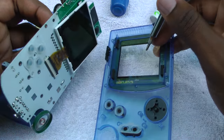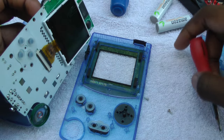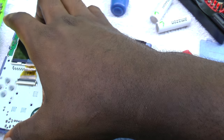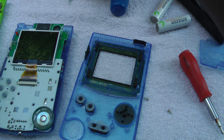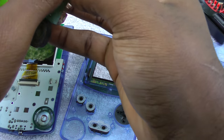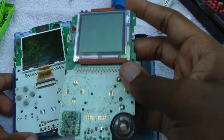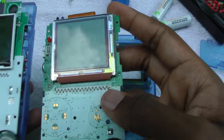As you can see, it just requires a little bit of force on the outside. And there's the adhesive — you can see it on the lens. And unlike the Game Boy Color, the screen ribbon cable connector is actually on the front, as opposed to on the back. So here's a quick comparison of the two.